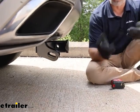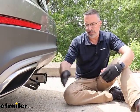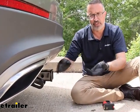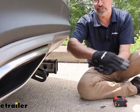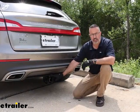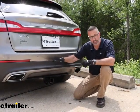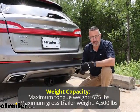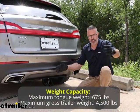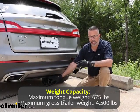These numbers are important if you're choosing accessories such as a ball mount — you'd want one that comes out and has a rise to match your trailer. Or if you're looking at accessories that fold up when stowed, you wouldn't want them to contact the back of your fascia. As for weight capacities, the tongue weight rating — the force pushing down on your hitch — is 675 pounds. That's quite a bit; if you have a big four-bike rack carrier or a cargo rack with a generator on it, that's plenty strong enough.